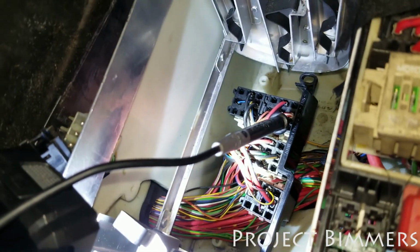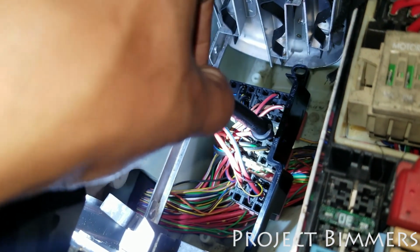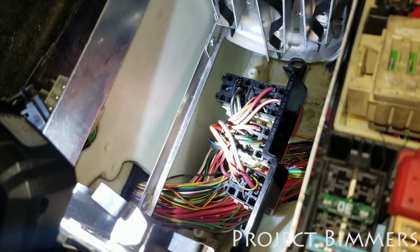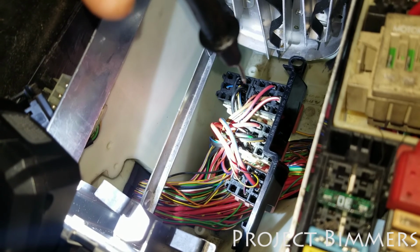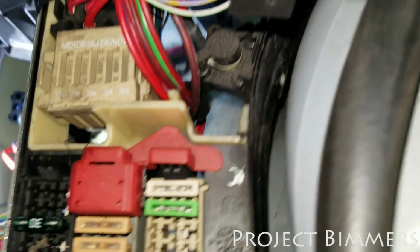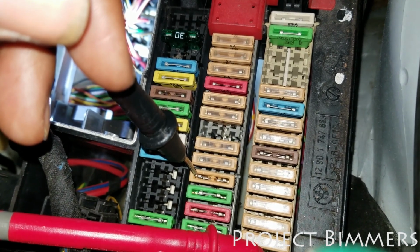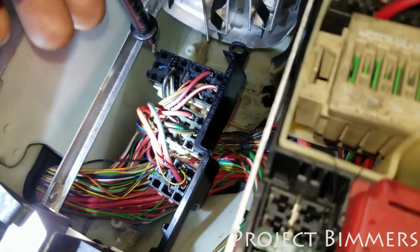Okay, another connection that should be made is the relays receive their positive on the trigger. So a trigger for a relay is supposed to have a positive and a negative on the coil, and that would turn on the relay. So these relays are receiving their positive signal from the fuse, that number 5 fuse. So that would be this fuse right here. So this fuse should be beeping when I touch the contact for the relay, which is here.